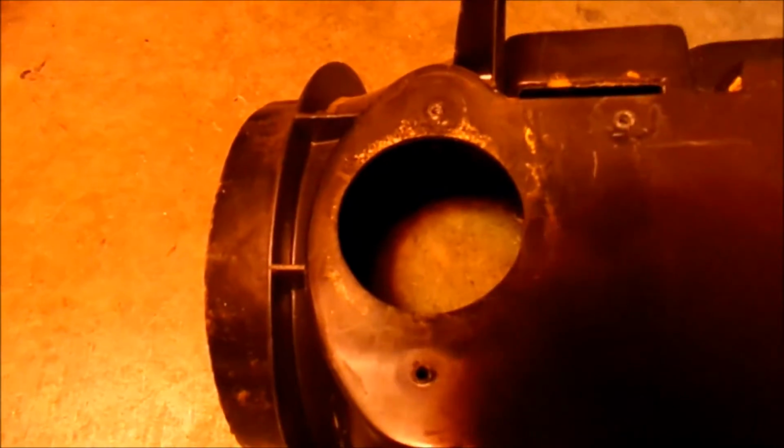And here's your cover, and that's where that vent connected into the box. And there were bolts on top that weren't in there, so I didn't have to access those. So know that you'll have to go and probably feel for those, probably 7mm with an extension, to even get that off. But I got lucky to get it apart that way because it wasn't put all the way together to begin with.